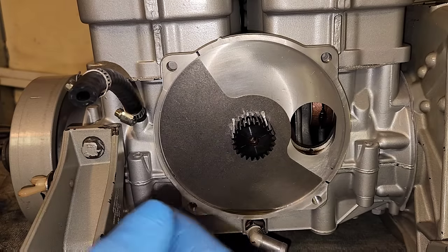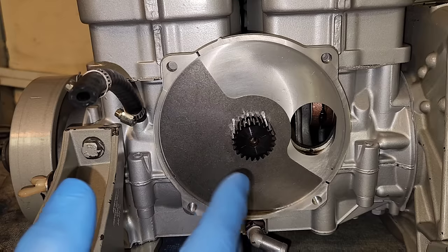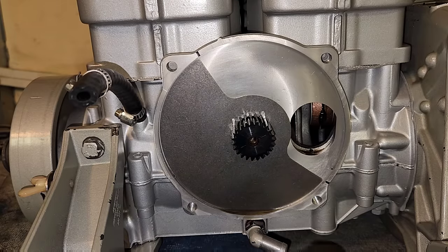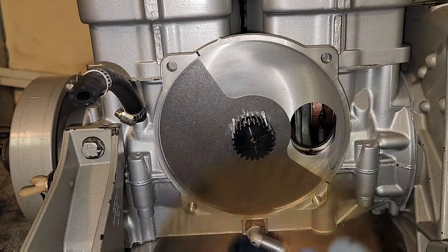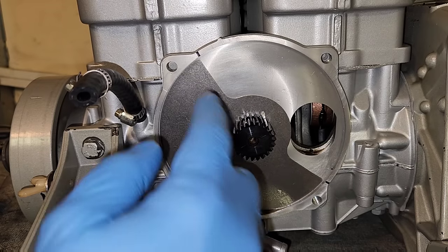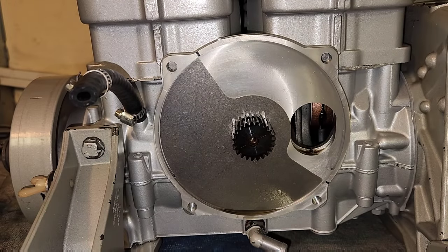Of the two marks that you have there, at that point you have it set. I'm going to show you setting up the top dead center, but that gives you an idea about what you're looking at before you put the valve on. Obviously you would have had to run the green mark around and get those marks done and line it up to the top and the bottom point. But you do have to have the engine at top dead center before you actually put the valve on.